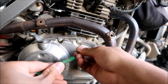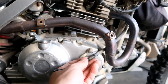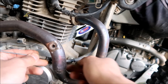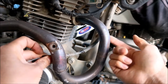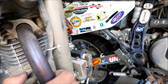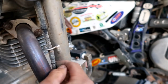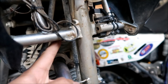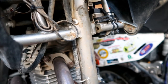I'm going to pull my little green boot off because I want to reuse it on the new one - it's a little accessory I bought, Kawasaki green, looks cool. Take the nuts off so it can slide off everything. The exhaust is kind of in the way - push up to get some clearance to slip it under the exhaust. There's a loop going through there. Another spot it goes through is the little bracket on the side - there's an opening right there. Remember where the clutch cable goes through.